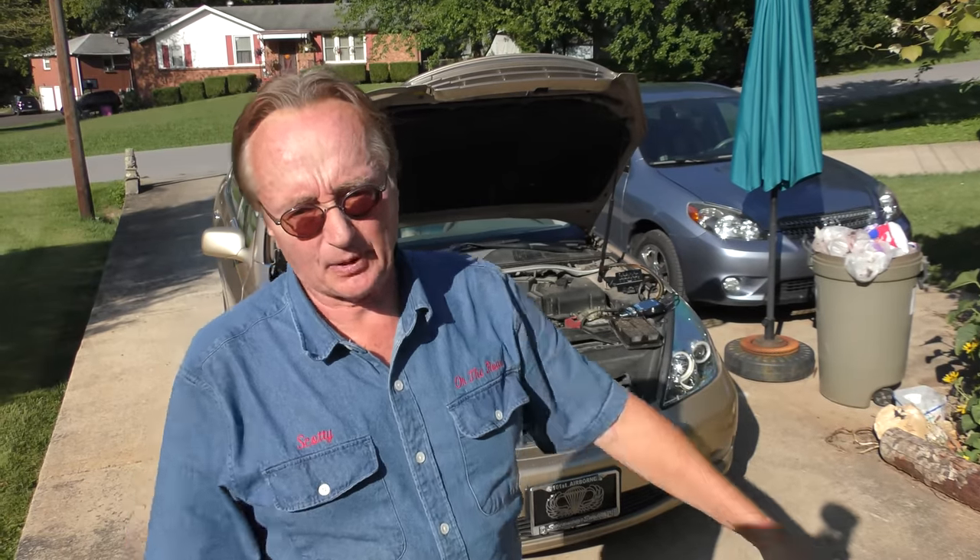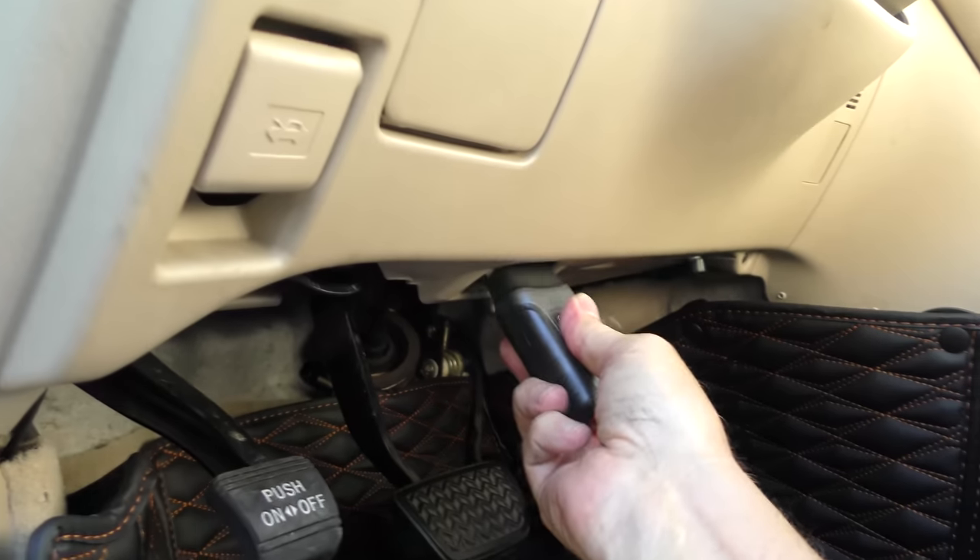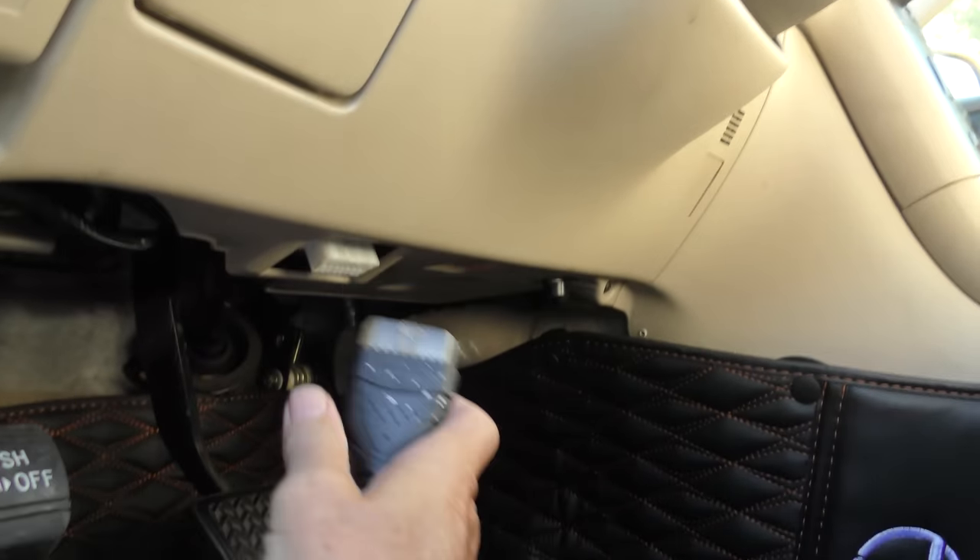I've had customers drive with those dongles, they had problems with the car, and nobody could figure out what was wrong. Here's why: to analyze what's wrong with the car, we mechanics plug a scan tool into the OBD port. So if you already have a dongle plugged in, we have to unplug the dongle, get our scan tool, and plug it in to diagnose the problem. But if it's an insurance dongle or one that supposedly gives better gas mileage, once we unplug that device to plug ours in — because there's only one OBD port — I've seen people bring me a car saying the dealer couldn't find what was wrong. Well, the dealer didn't do it right, because once they unplugged that device, it's no longer interfering, and if it was causing the problem, the problem will be gone.